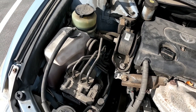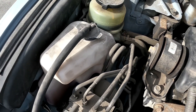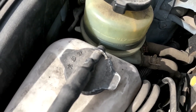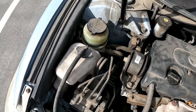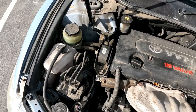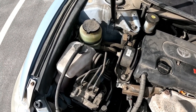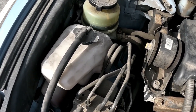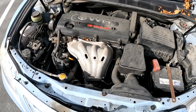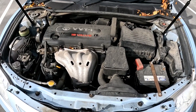When you or your mechanic is going to refill the cooling system after a drain and flush or drain and fill, the expansion tank will need to be filled. Open the expansion tank cap, refill it, and then start the engine while the cap is open. The water pump will start sucking all the coolant in and air bubbles will surface up. If you don't do this, there will be an air pocket in the cooling system and that is going to cause your engine to overheat.